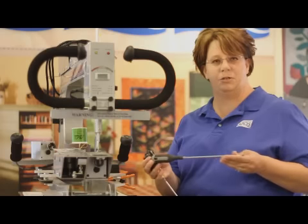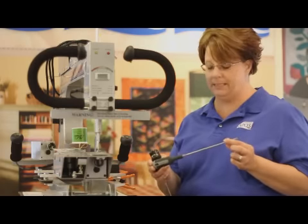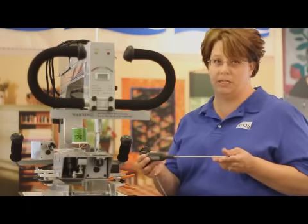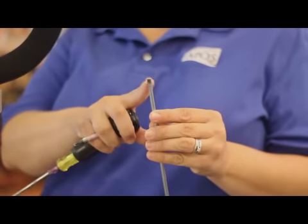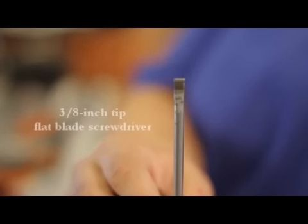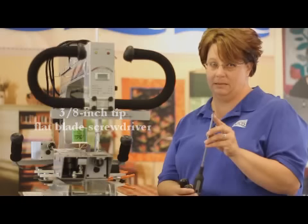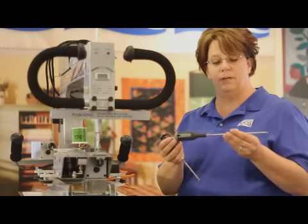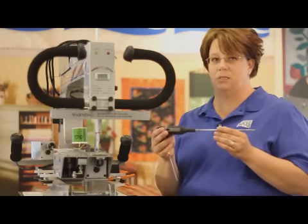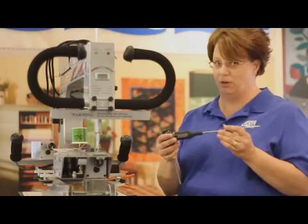The first tool is a flat blade screwdriver, used for adjusting your needle bar height. The access holes for the needle bar clamping screw in the machines are fairly small, so the tip needs to be fairly narrow — some businesses call this a cabinet tip screwdriver, where the tip width is 3/8 of an inch or less. A nice long handle is very important because you can get more torque on your screws and make sure these adjustments are not going to fall out on their own.